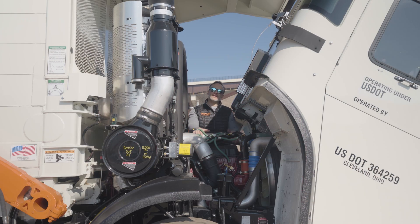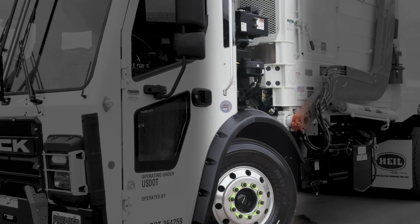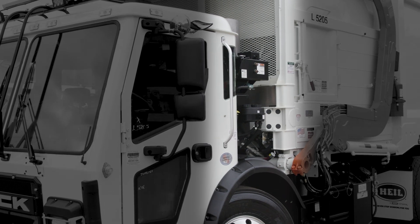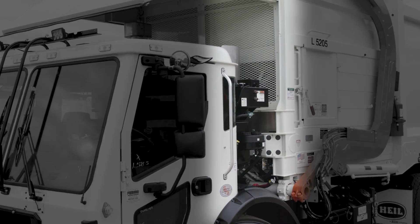One of the great things about the design of this truck, too, is the fact that Mack has designed this similar to other trucks — everything is on one side of the truck that you need to look at in order to service. On top of that, there's no need to lift the cab to do things like check the oil, coolant, power steering, any items like that. All the dipsticks, all the reservoirs are right over here, right where you can see them from the ground. Easy access, once again making sure that you're able to stay up on maintenance and pre-trip inspection.